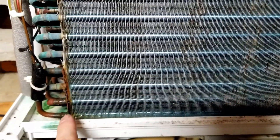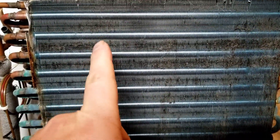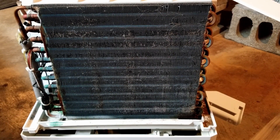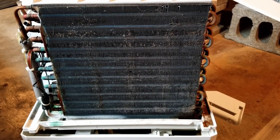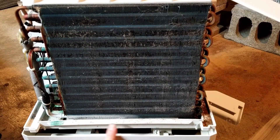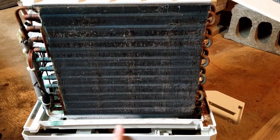The problem is it's supposed to frost up on this whole heat exchanger coil. Seeing as how that frost buildup stopped there and didn't really continue — once the copper tube reaches that temperature, it'll slowly transfer along the copper tube to about there, and then call it quits before the ice builds back up.